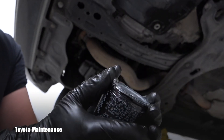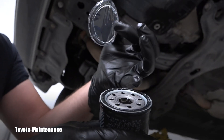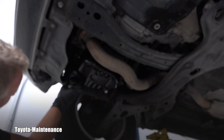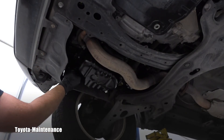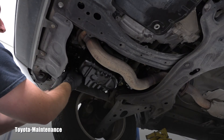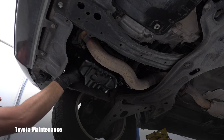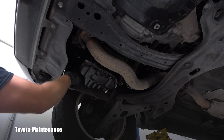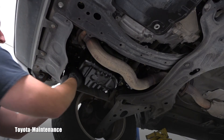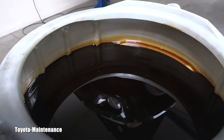The filter has a plastic cover on the bottom that you must remove, because it protects the grease on the O-ring. You do not need to add extra oil to it — it's pre-greased. Carefully catch the thread on the oil filter housing and tighten by hand only — no filter wrench. That's it, perfect.